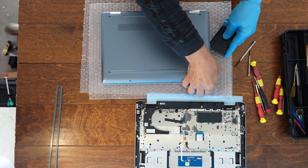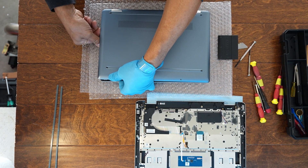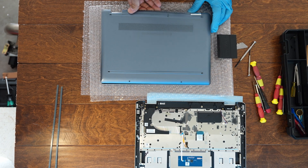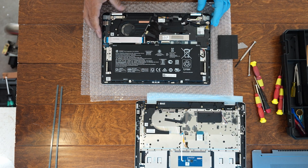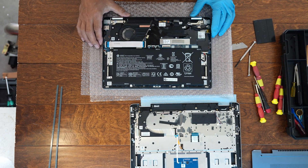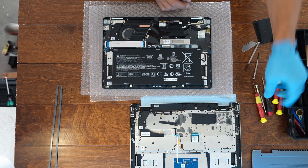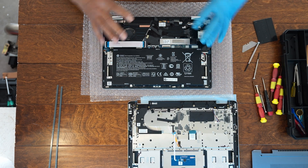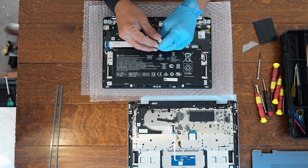It's not fighting back at all. This is the back cover — it's all plastic. Now we have a couple of things. Comparing the two units, we have a battery. The battery is hooked up right here, and there's the motherboard. So we'd have to separate the motherboard and transfer everything — the fan, motherboard, battery — to the replacement keyboard frame. This really is just a case, and you transfer all the guts to the new keyboard chassis.